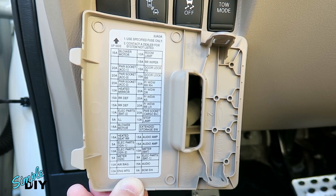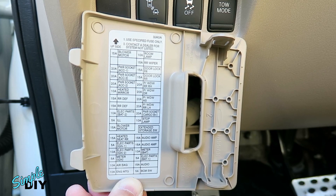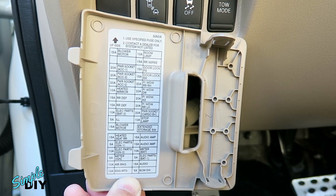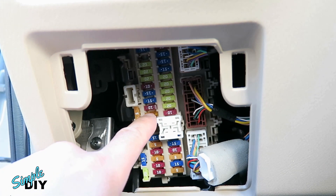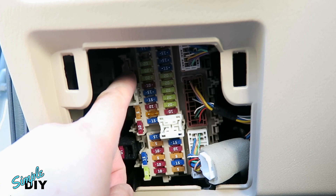This is why I highly recommend you get a multimeter and test the fuse to find out if it has ignition 12V or constant 12V. Also make sure you don't tap into any circuits that are critical for the operation of the vehicle — for example, you don't want to tap into the SRS airbag fuse or the ABS fuse. Looking at the fuse panel, this 10 amp fuse will provide constant 12V, and at the very top, this 20 amp fuse has ignition 12V.